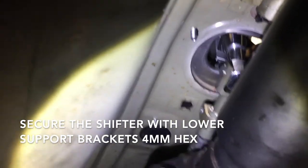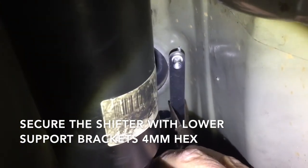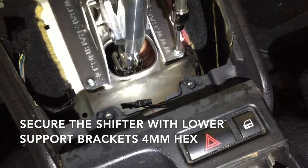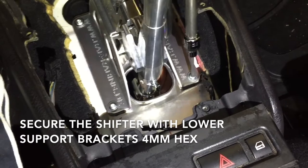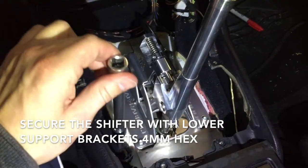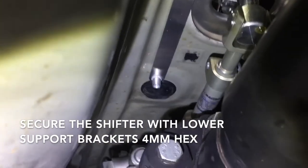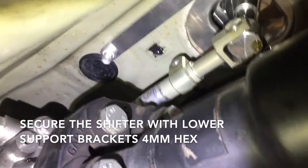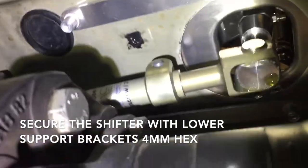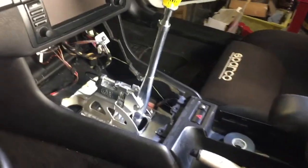Go ahead and put on your lower mounting support brackets. We're using the long bolts so we can use up all the thread. Below, holding the lower supporting bracket, I can take my four millimeter hex key and start the thread process. Take note that we use the long bolts so that we can take advantage of all the thread on that support bracket — go ahead and take all four down hand tight. From below, we can see that the longer bolts supplied from CAE went through the lower supporting bracket perfectly. If you're using these brackets, I suggest using the longer bolts. Double checking everything, nothing is bound — shifter mounted in, we can now begin fine tuning.